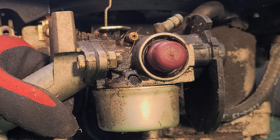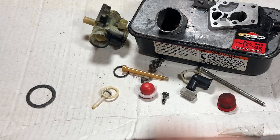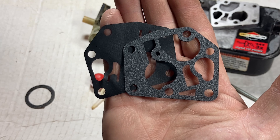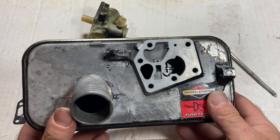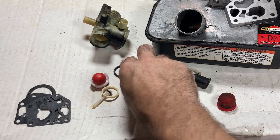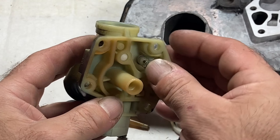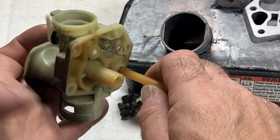That's all done in the ultrasonic and it actually came out looking really good. There's a new primer bulb, diaphragm, and gasket - the new primer bulb part number and new diaphragm and gasket part number are all linked below. The bowl came out really well so let's rebuild this. The spring just goes on right here, the pickup tube goes here - push until it clicks.